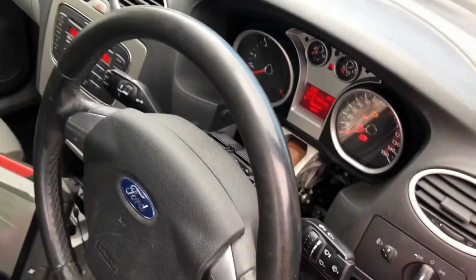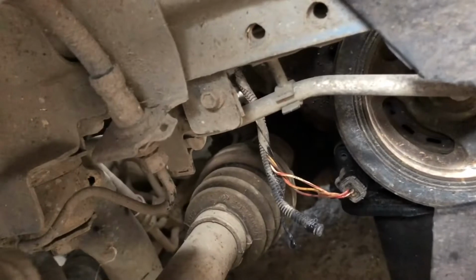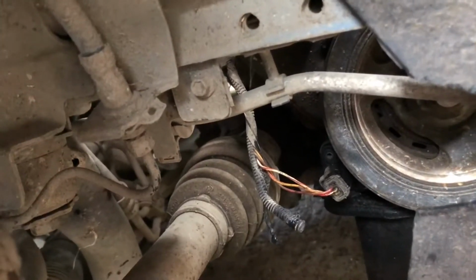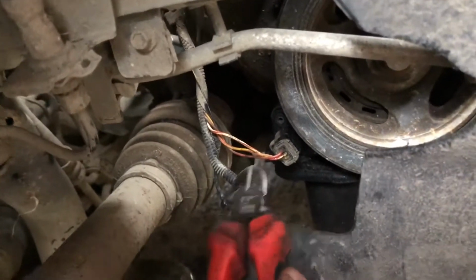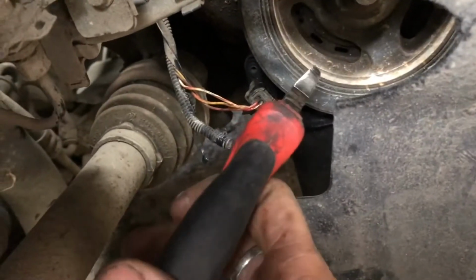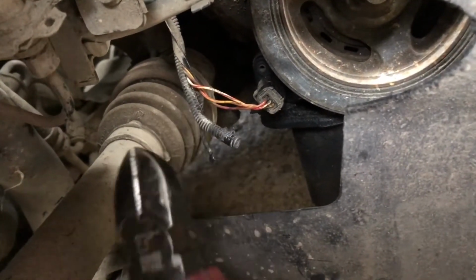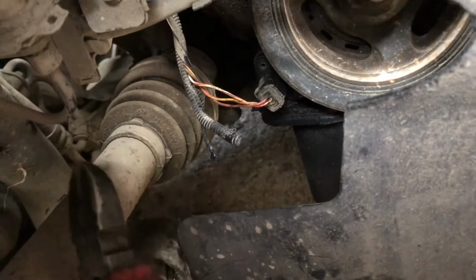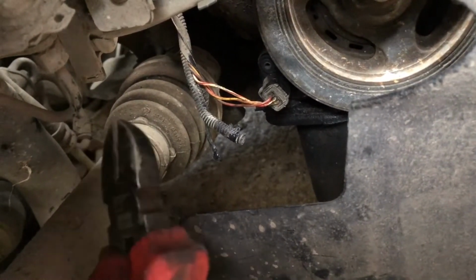Anyway, good start. Okay guys, this might be seen as real crazy stuff, but it's getting late and I might be going home. Curiosity is killing me. When I'm turning the key, I'm seeing weird stuff at the crank position sensor. There's my crankshaft position sensor. Scoping on the signal wire up at the ECU, I'm seeing what I call interference coming from the injectors. If I disconnect the four injectors, this thing cranks over like mad, and it should.